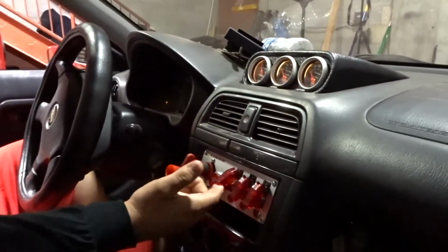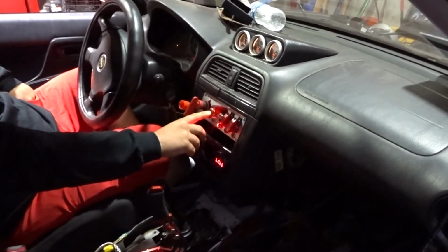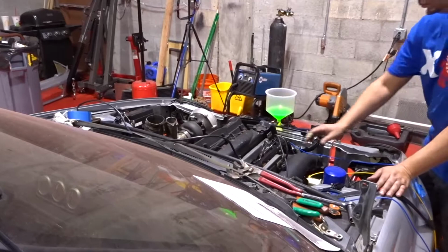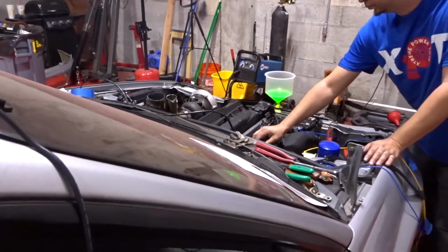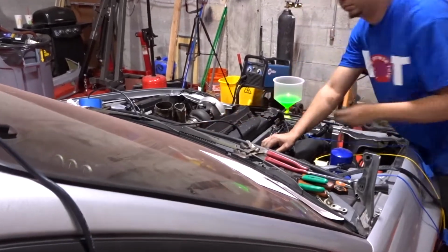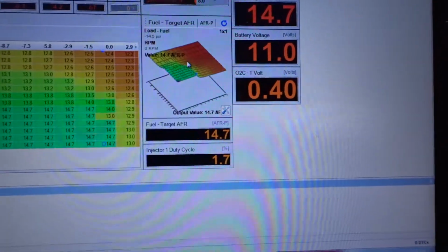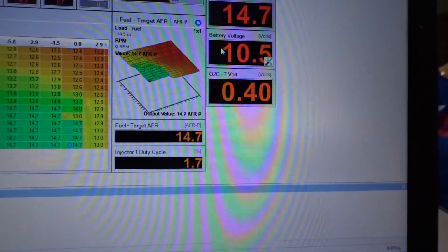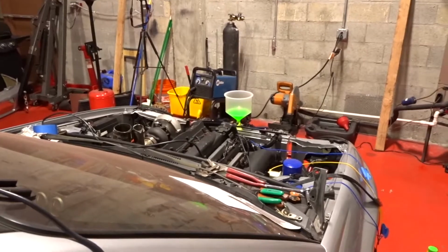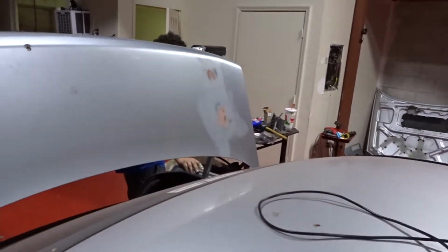Turn on the fuel, the first one. Now push start. Do it again. I have 11 volts. Mario, hit it again. 10. Well, we're gonna try a new battery and see. But right now you can hear the starter, but it's not cranking the engine. So Alan has a starter pack there.